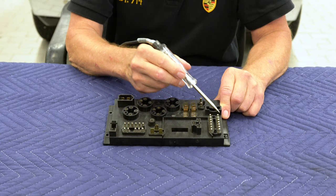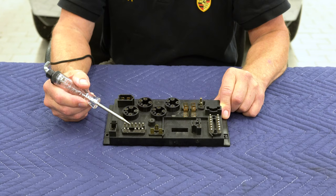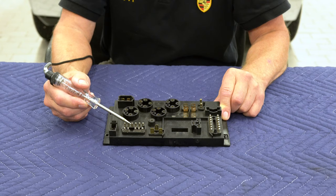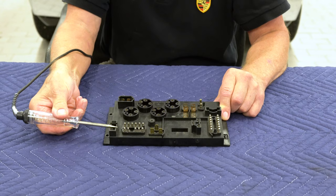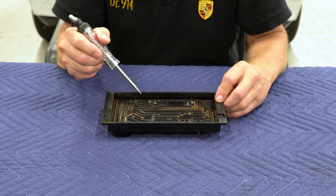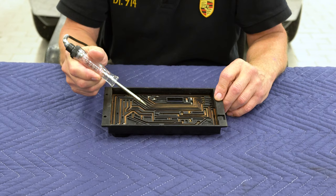This is the front of the car, this is the rear of the car. This is the ignition harness connector, which goes to the coil and to the auxiliary air valve, and goes back to the starter, and also goes to the reverse light switch. This is the plug-in for the control unit on 1.7s and 2-liters only. This is the holder for the harness. If we turn this upside down, we can see the circuits here. Notice very few are soldered.